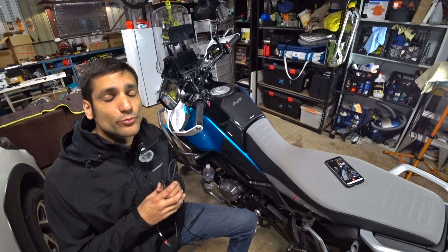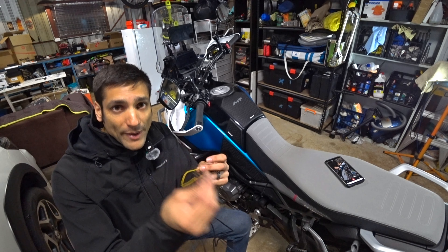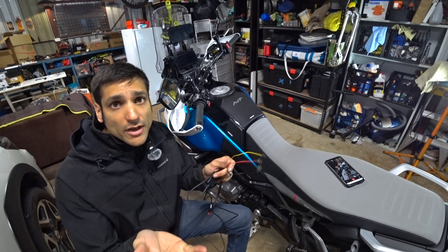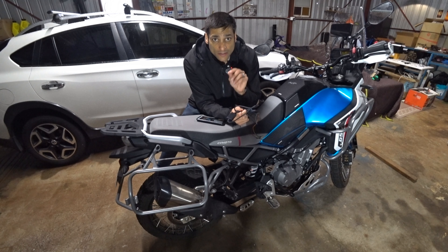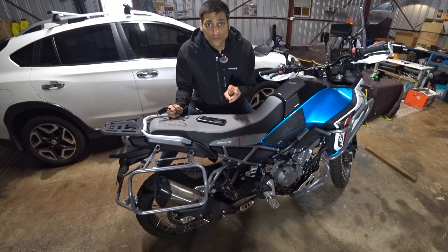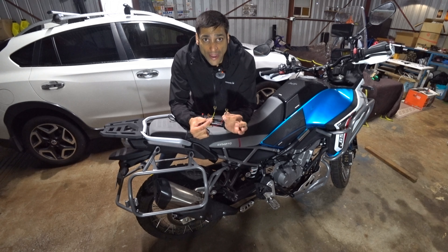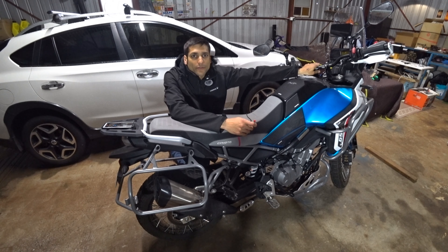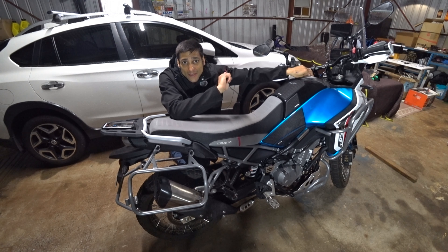A lot of modern bikes are coming out with this feature, which is brilliant. But if you don't have it, it's not a big deal breaker — you just connect your negative and positive to your battery terminals and then the ignition wire to something that turns on when the ignition is on, such as a rear brake light or an accessory port you may already have for heated grips from the factory. Because this cable is so long, I'm going to take the easy option and route this to connect power from the accessory port under the seat on the 450MT. It's a negative and positive terminal that is also switched to the ignition, so I've got to trick it to think it's connected to the ignition as well — essentially the black goes to the negative port and the yellow and red will both be wired to the positive. A handy tip for routing cables: look at where your existing cables already go, follow the electric cables running to your handlebars for your switchgear, and just copy that routing.